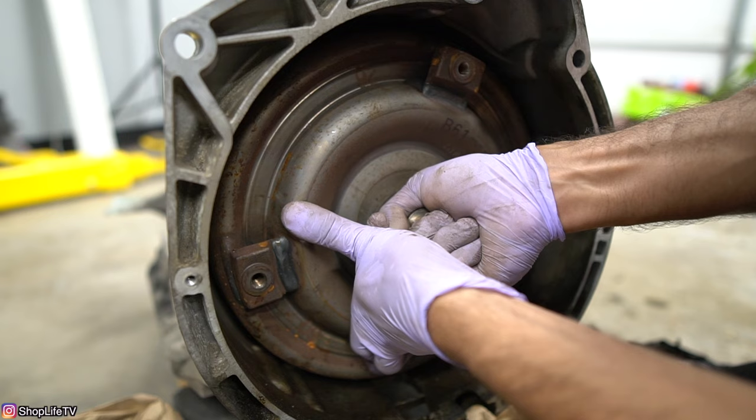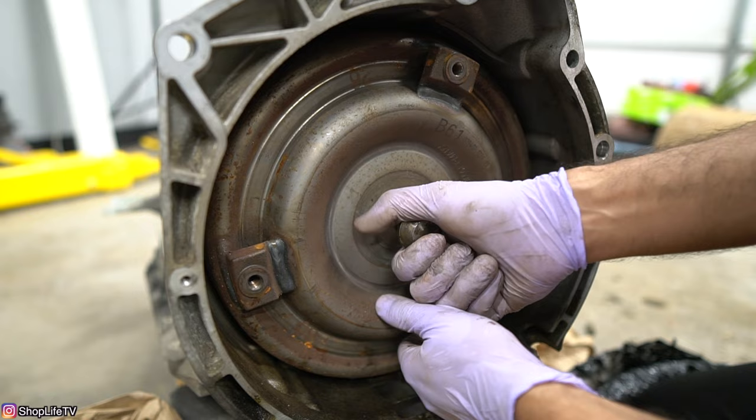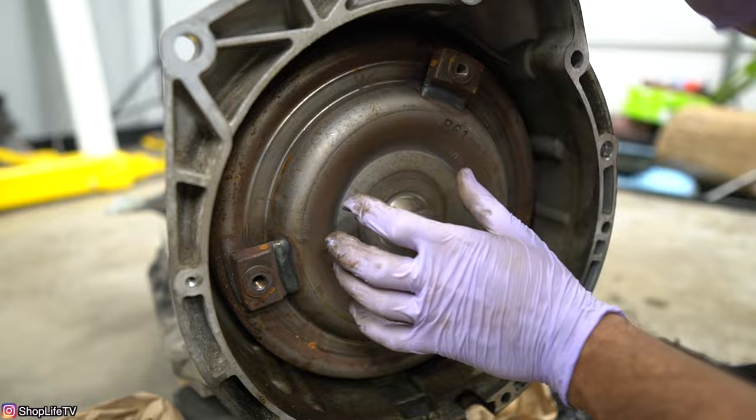There's the third one — now we're in all the way. You can see there's a lot less movement now. There's still going to be a little movement because it can move slightly on that shaft, but you saw the three stages. That third stage is the one that engages the front pump with those prongs on the torque converter.